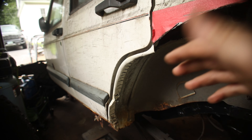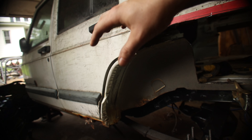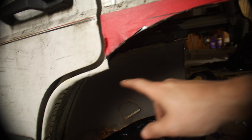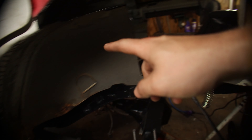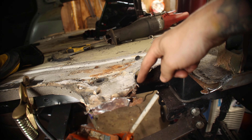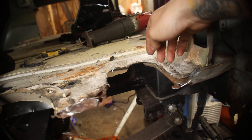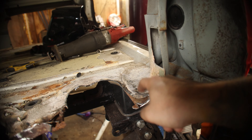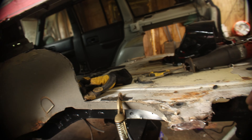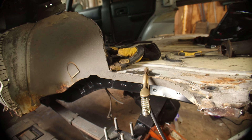So I've got this all pinched and folded over. It looks good. You can see plenty of room for a 40 now. I've still got to cut off this little nub that sticks out — this is where the filler neck was — cut this off straight so it matches the other side. On the other side I have to fix this right here because it's rusted. Then we can start forming the inner fender and the whole inner wheel well and start building new.